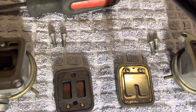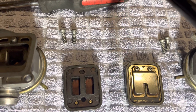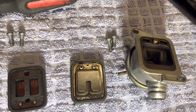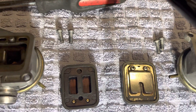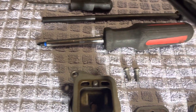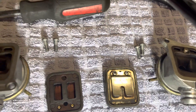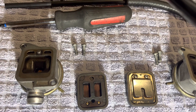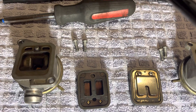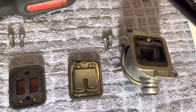These screws are JIS screws — Japanese Industrial Standard screws. According to Google, they're about the same size as a Phillips number two. I verified it, and it is true. You do need some leverage when you take these off. But caution — please don't use just any Phillips. Use the proper size Phillips for these screws, and then just put a lot of leverage on the first opening.